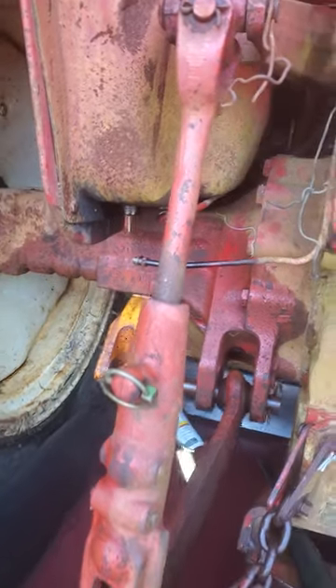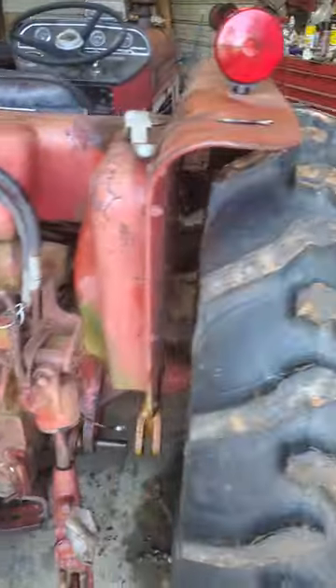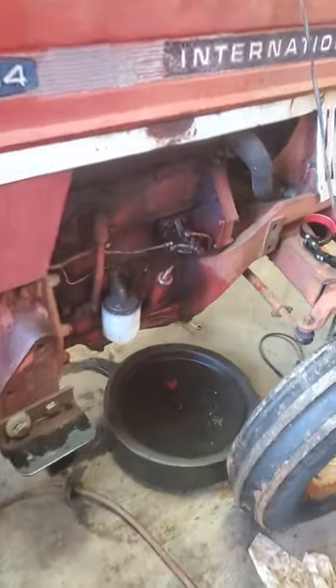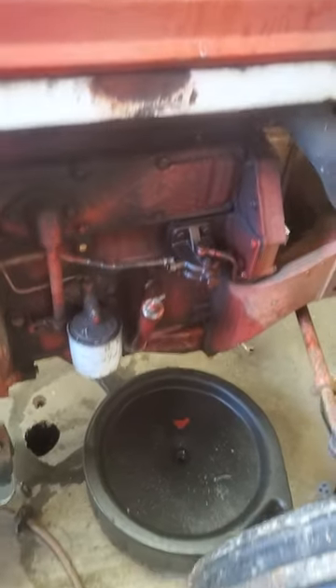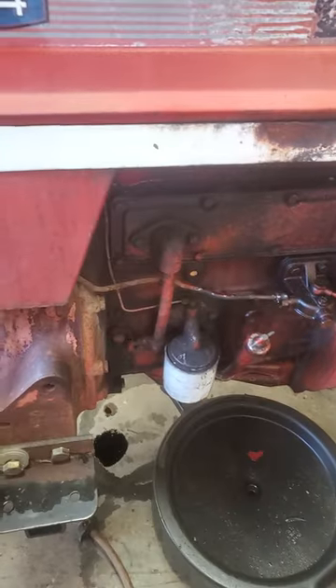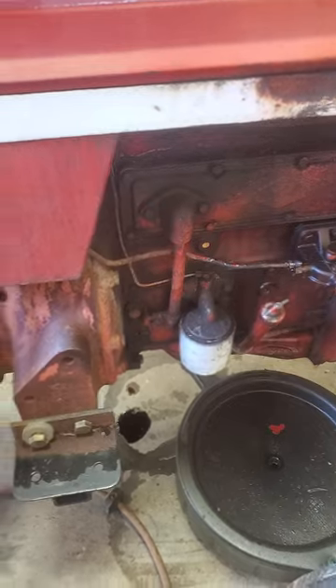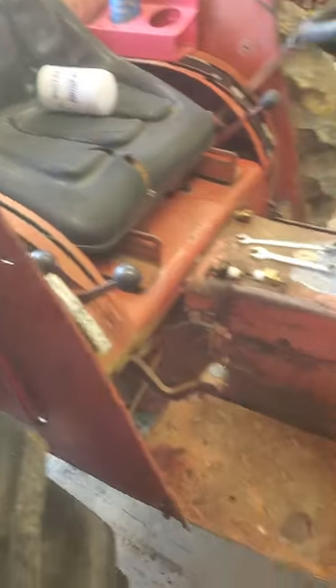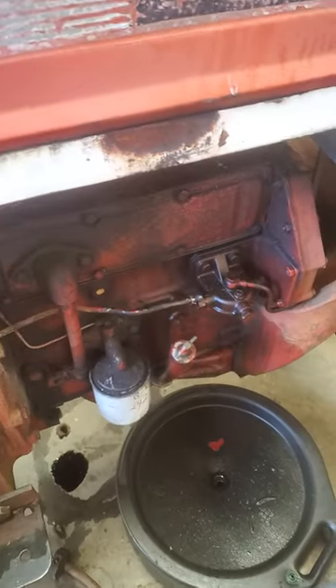You've got two fittings over here. I disconnected the fuel line up here at the fuel filter, and there was no fuel, or very little fuel. So I blew through it. You hear the normal stoppage sound and stuff popping and blowing through in the tank. Once I did that — boom — got plenty of fuel.